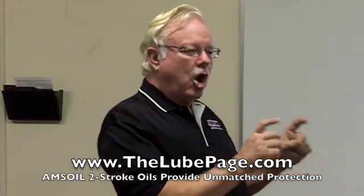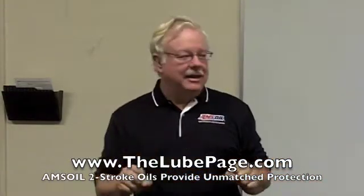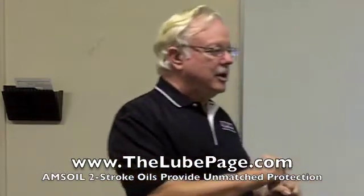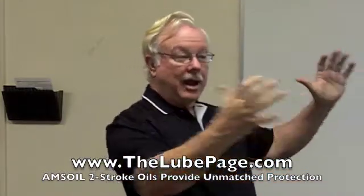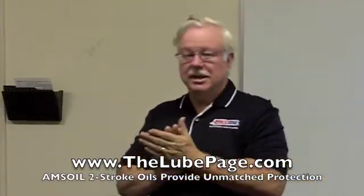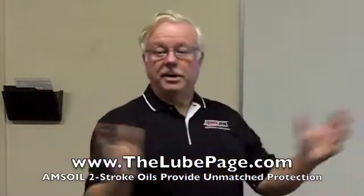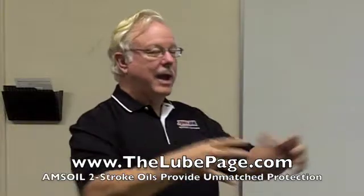And the reason is carbon is attracted and sticks to the residual zinc that was left from the oil. So when the zinc gets stuck around like you want it to, it's got to get stuck on there to protect the metal. But it makes a really nice place for the carbon particles to stick to. So carbon starts building up on the zinc. And I throw more zinc on that, more carbon on that. I'm just building up like beeswax.